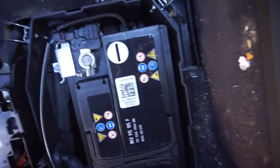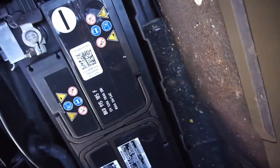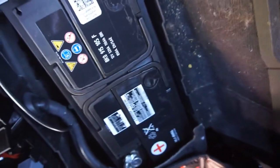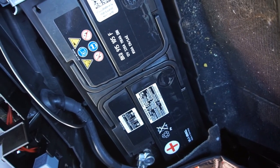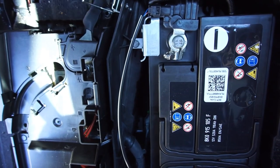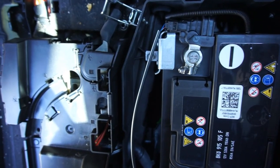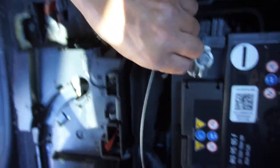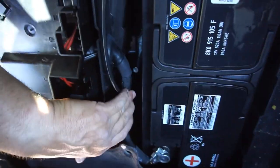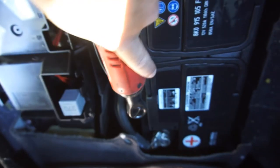Battery looks pretty good actually - it's like a newer battery. MLA, made in Germany. So I got a 10 millimeter here. Basically you just take this 10 millimeter - and then there's one right there that you have to undo which I might need an extension for.